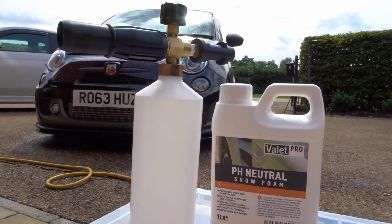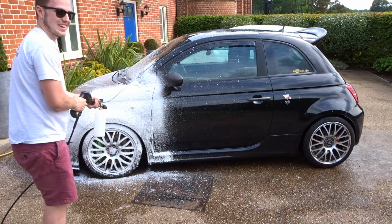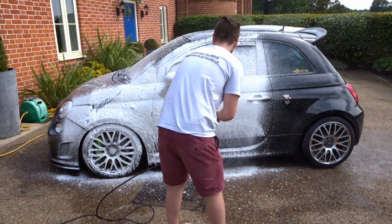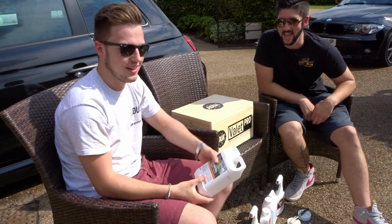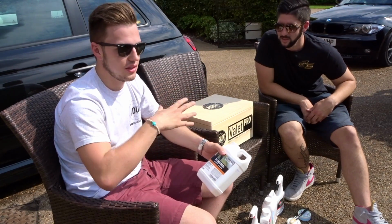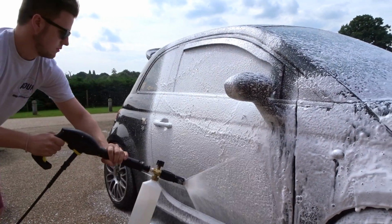And the thing that we all talk about amongst the community when it comes to snow foam is you want that really thick snow. The Auto Bright stuff that I used in my previous video was not thick at all, but this stuff was ridiculous. Yeah. The thing is, you can get some snow foams that are too thick, as we call them, Instagram foam, just for the show. And they don't do much. They sit on the surface, they'll do their little bit, but they won't clean the surface of the dirt and contaminants which are there. This pH neutral snow foam, yet again, a pH neutral product.